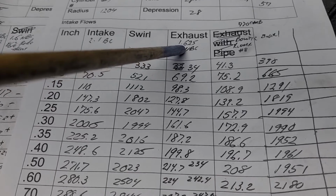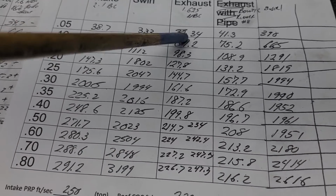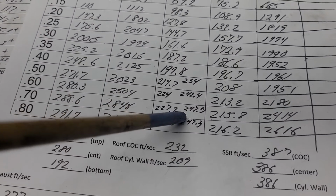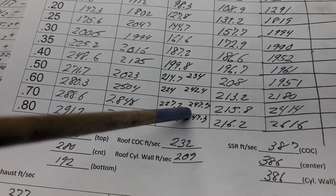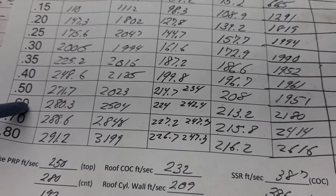And the exhaust I finalized as a 1.625 because the seats were kind of beat, so I wanted to go a little bit bigger seat to get some fresh iron and keep the seat high. This actually flows quite well. 247.7 at 700 is pretty darn good.